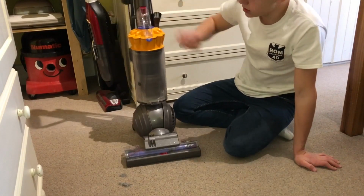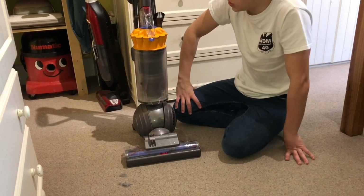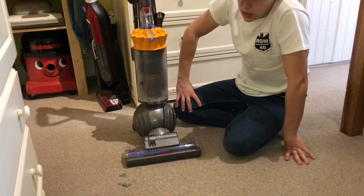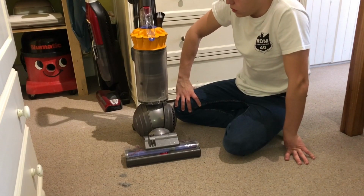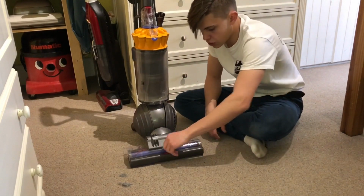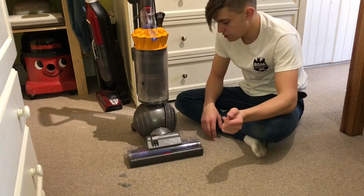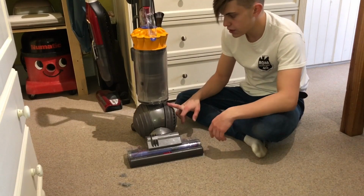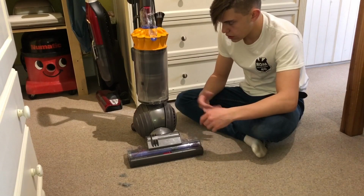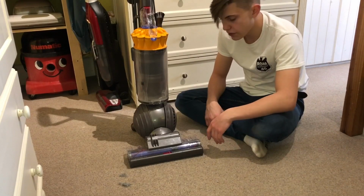It is a Dyson DC40 Mark II. Now, yeah, this is what I've got. It's an ERP model, so it's got the slider thing on the brush roll. It's been fully stripped and cleaned. It's had a 1300 watt motor fitted. The original was 700 watt. And, I mean, why not? Let's give it a go.